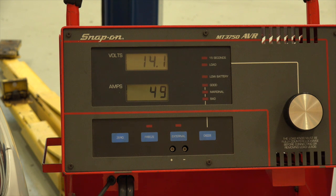I've got a positive number and voltage showing 14 volts. Using common sense, I know that alternator is charging because I shouldn't see over normal battery voltage with key on, engine off. This battery was a little low to begin with, so I know it's charging. Even if I see negative current numbers, if voltage is above 13 volts, I know that alternator is charging.